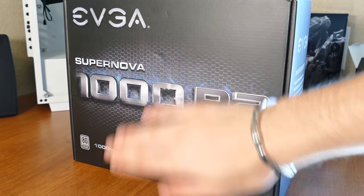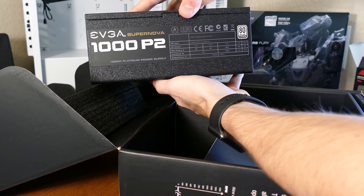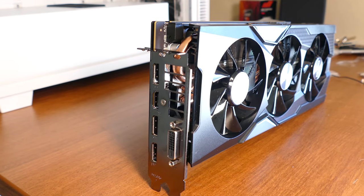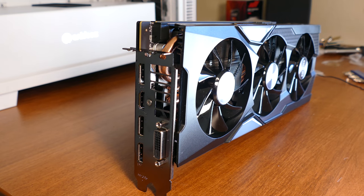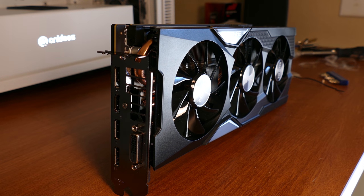The other overkill component is the power supply. I only had a 1000W P2 from EVGA on hand, but I did link a solid 800W power supply much cheaper in the description. The graphics card we're going with, the AMD Sapphire R9 Fury, demands up to 400W under the most strenuous GPU torture tests when unlocked, so an 800W power supply will keep us well within the efficiency curve.